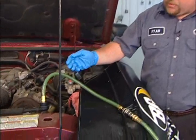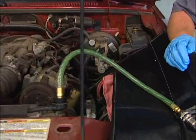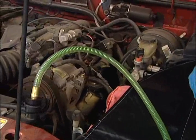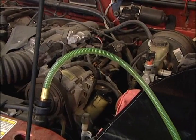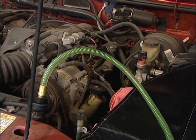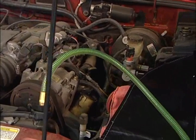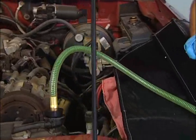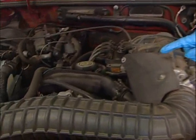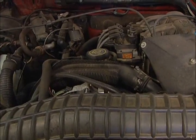As we can see, we're getting air bubbles right now — that's telling me we're getting to the end of our extraction process already. We're going to let it run to the two minute period to get as much fluid out of the vehicle as possible. We know the service is working because the whole goal is to pull a vacuum on the cooling system.